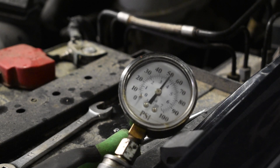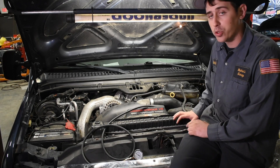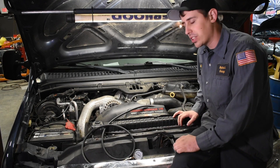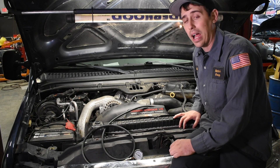This particular truck actually has pretty decent fuel pressure, but a lot of these, as the factory return spring gets worn down, will only come up to maybe 40 PSI — I've seen some a little worse than that. The goal is definitely to get it up over 50 PSI. The higher the better; if you can get it up into that 60–65 PSI range, it's definitely ideal. Now we've checked the fuel pressure, we're going to go ahead and do the blue spring. It's relatively simple — the average entry-level guy should be able to do it in the driveway in a couple of hours at most.